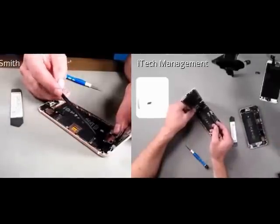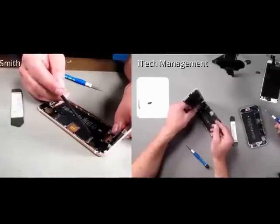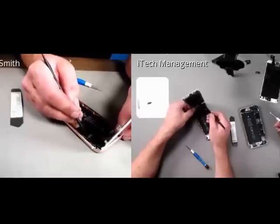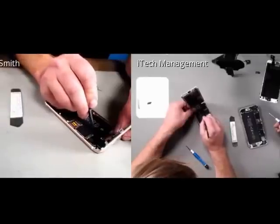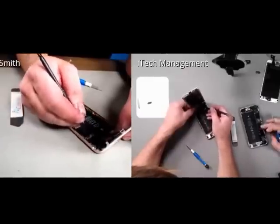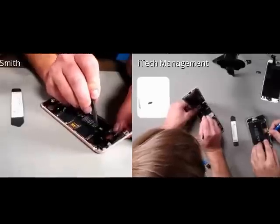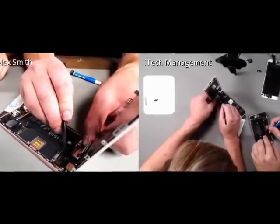So just some quick things that we noticed on the 6S display is there's only 3 cables as opposed to the 4 on the iPhone 6, which is great news because it's always somewhat stressful when you're trying to gently push down the cable, but you can't get it to stick. A common mistake is applying too much force to these cables, which can damage and bend the pins, which is sometimes responsible for both white lines and dead streaks on the digitizer when you're trying to use the touch sensor. But I will be popping the 3rd and final cable off right now.